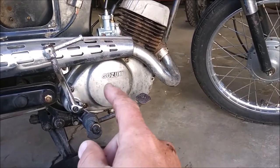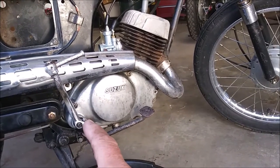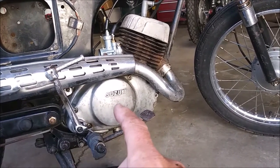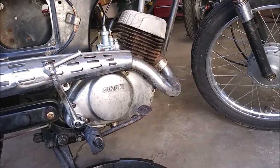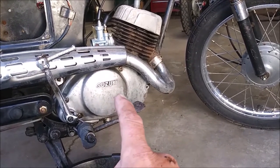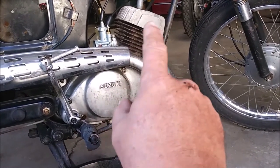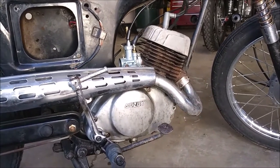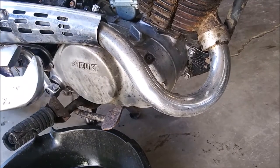But the crankshaft seal is above the level of the transmission fill line. Okay, this is the fill line, this is the crank right here. So I'm hoping it might be a seal between the transmission and the crankcase. So I'm hoping that lowering the level of the oil will stop extra oil from going into the system and causing me all sorts of smoke. So we're gonna investigate and maybe we'll get lucky. Hold on a second. All right, first things first, tighten up the drain plug.